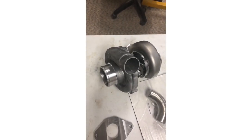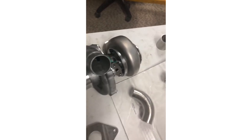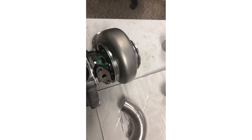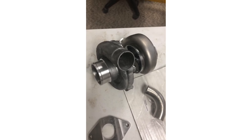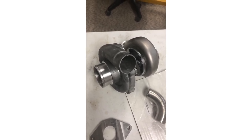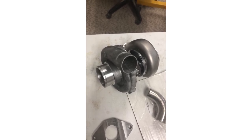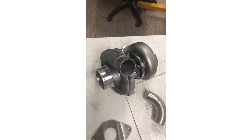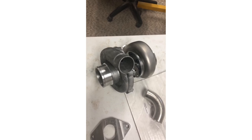Then I got the coolest part of the whole thing: my turbo. It's a Garrett GT 3682. You'll notice the exhaust housing is stainless steel, which saves about five pounds off a traditional turbo. I had to have it made in a journal bearing series rather than ball bearing, because from the research I've done, in an airplane where you're running high RPMs more consistently than in a car, journal bearings last better. The advantage to ball bearing is it spools up faster, which isn't really an issue for an airplane.